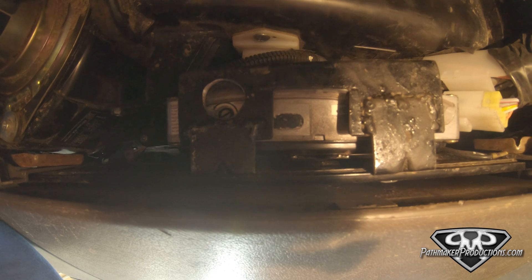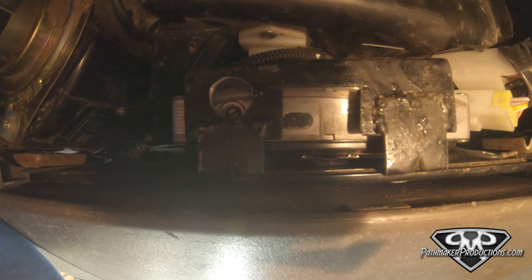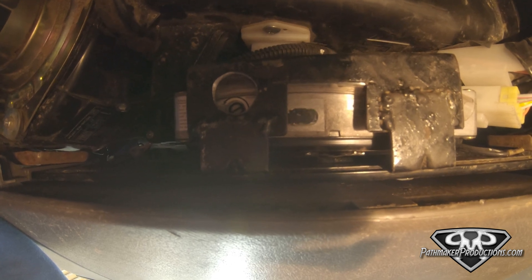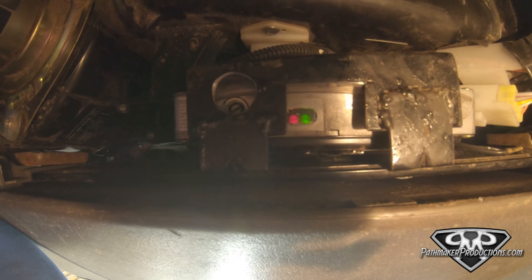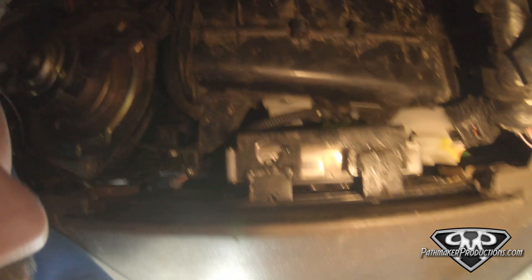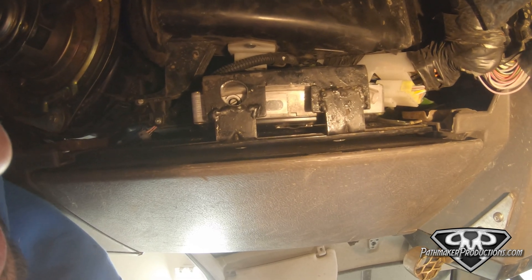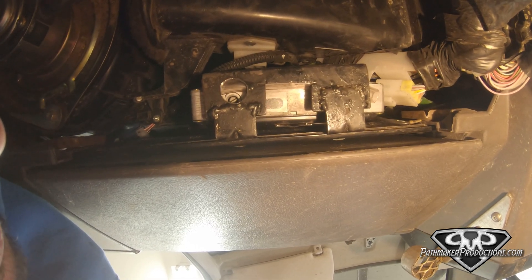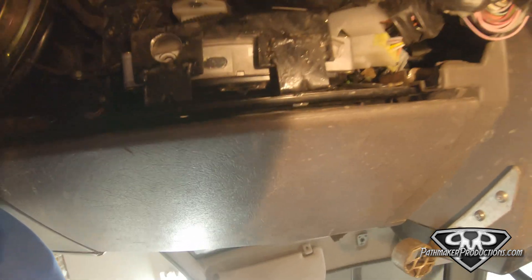The lights are blinking through the modes. Both lights will blink once for mode one, twice for mode two, three times for mode three, then four and five. Those are all test modes. The one you're most likely going to want is mode three, because that is the one that will pull your ECU codes.